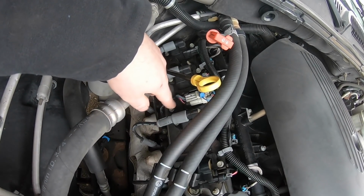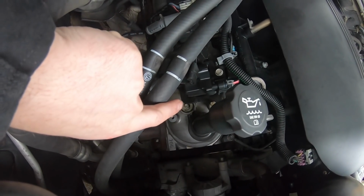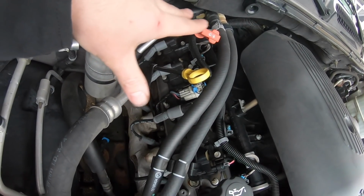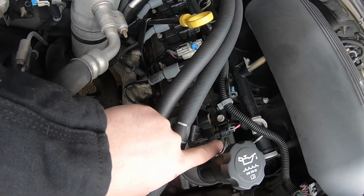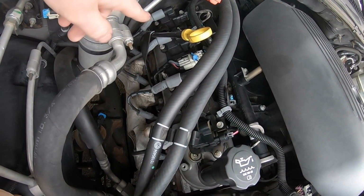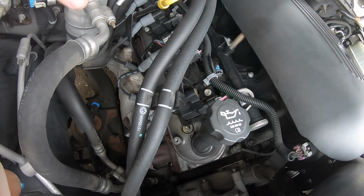You take that off and then the little harness going to each coil actually stays on the bracket. And then the bracket itself has to get unbolted from the cover, because if you can see here, it's kind of covering the bolts. And when you get towards the middle, the bolt's completely covered. So that bracket has to come off. That's just held on by random 10 millimeter studs. So I'm gonna zip them out with the ratchet, get the wires off, the connector, and then it's just the 4 8 millimeter center bolts for the valve cover, and that's it, the thing comes off.